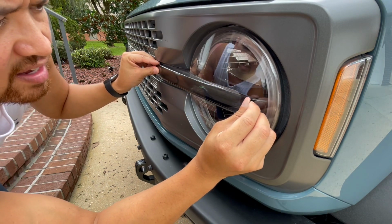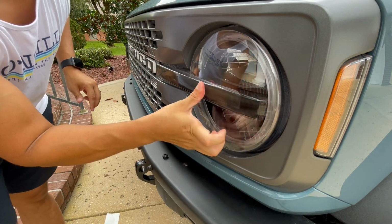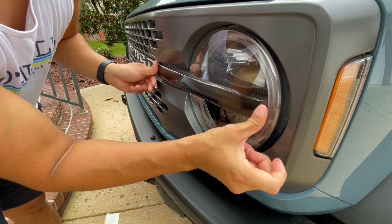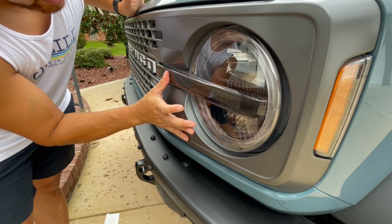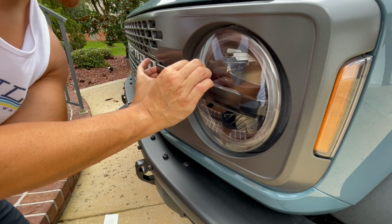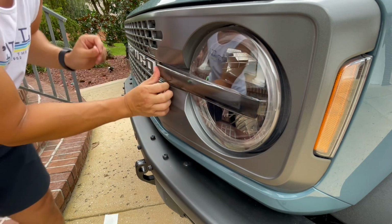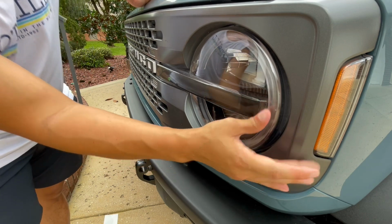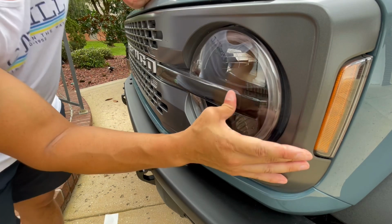If you already have a felt tip squeegee, that'd be good to have around. We do sell them on our site, and they do come with some of our larger vinyls, but you don't necessarily need it. So I'm pushing out all the liquid to one side or the other. Of course, the squeegee can put a little bit more evenly distributed force on the vinyl. But in a pinch, your fingers work, and your fingers, as long as you don't scratch it with your nails, aren't going to damage the vinyl at all.